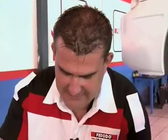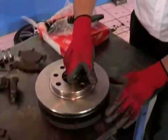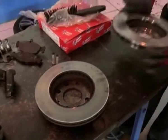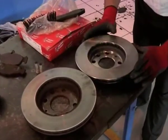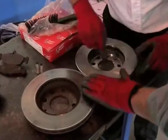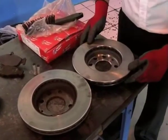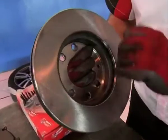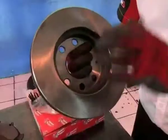Remove the new disc from the packaging. A tip is to always compare your old disc with the new disc you've ordered to make sure it has the same specifications. You can do this by checking the diameter of the two discs, as well as the offset and the bolt pattern. Note the thin oil film on the disc — it's there for protection to prevent rust when it's shelved in the spare shop. We have to clean that off because any contaminant on the friction material might cause a failure in due time.